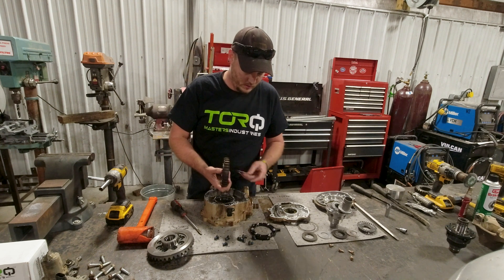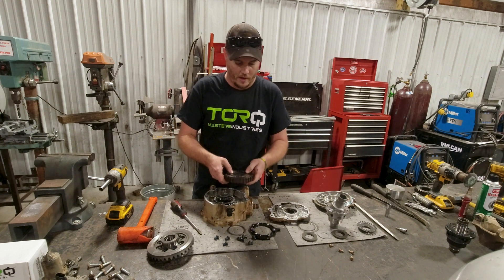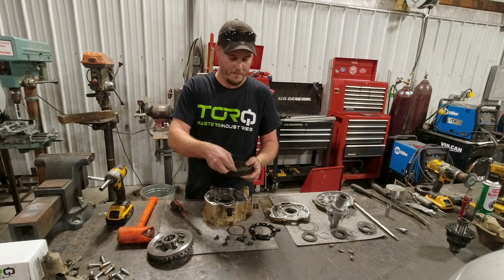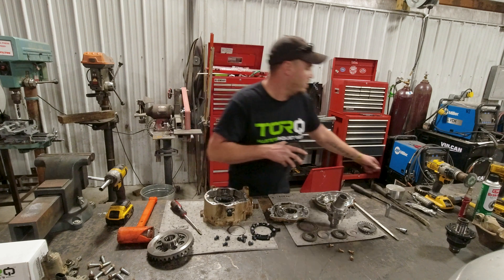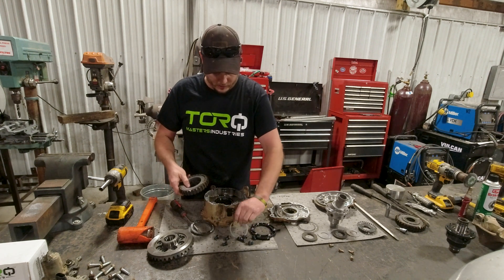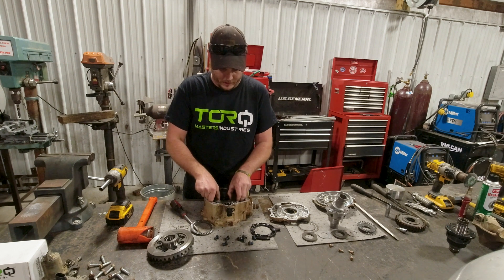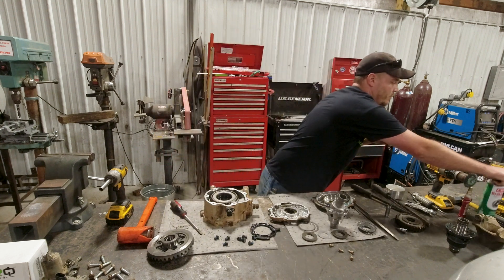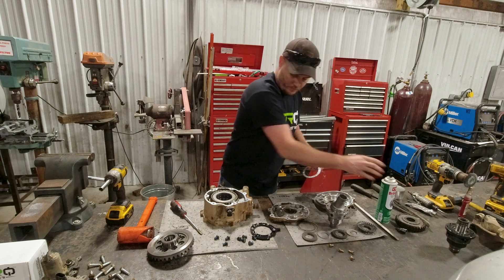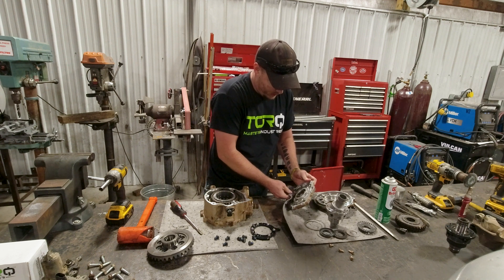The center on this clutch pack is too small for the new side gear to go all the way through. So what we're going to do is remove this. For the sake of the video I've already got one removed, but it's pretty simple - you've got a little clip right here on top that sits into a groove and all it does is hold the clutch packs in. This is what it looks like when you remove it - just nice and open so that side gear can fit right through there. We're going to reuse the shim that's there. Set that back down in place and clean everything up.